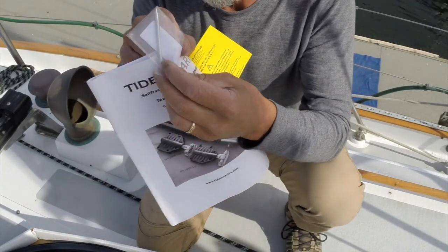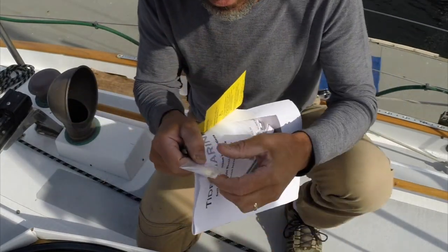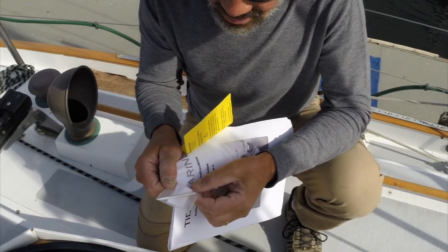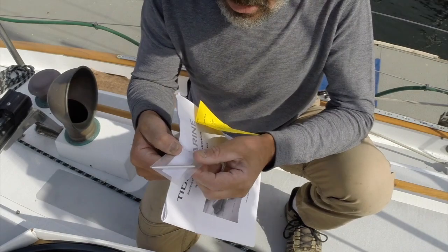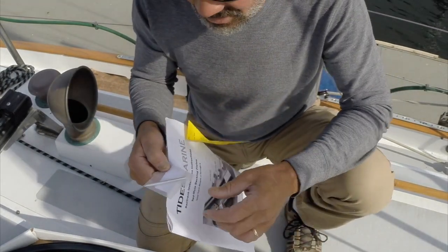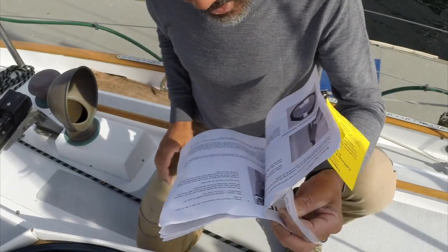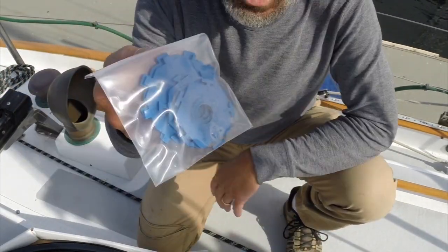This thing comes with a little installation tool. I had to make my own installation tool when we got the sail made — it's basically the same thing, a piece of 3/16-inch rod sharpened on one end, for feeding it through the luff of the sail. Hardware fits through here, and they even sent me an extra set of measuring discs to gauge the slot track.